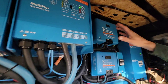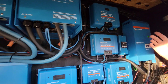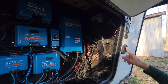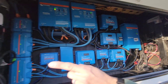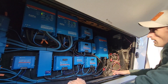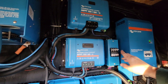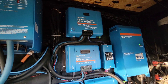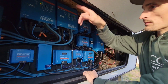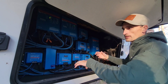I've got six solar controllers because we have six strings — four strings up on the roof and two portable strings for our portable panels. That's run by two plugs; the RV came with one plug and I added a second one because we wanted more portable panels. These breakers here are for the solar breakers on the roof. I have a different kind of circuit protection for the two portable panels. The wiring runs through the pass-through and up to the breaker panel box, where all our equipment comes together on a screen that we'll show you inside.